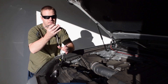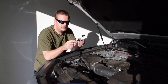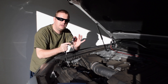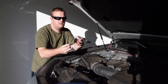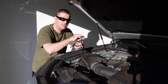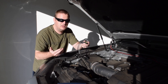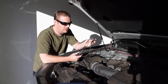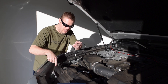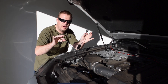On the driver you have a couple of different things. For the H11s, all of this would be inside your dust cover — this plugs into your factory harness, and on the outside you just plug the driver into the factory harness. It's essentially an extension to get the factory harness from inside the dust cover to the outside. For the high beams there's no dust cover to worry about, so you just plug straight into the driver and this extra wire is not needed at all.